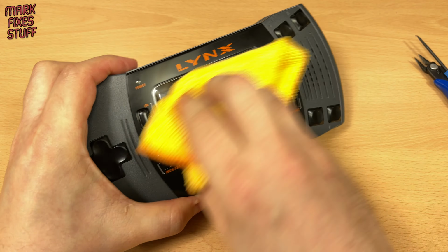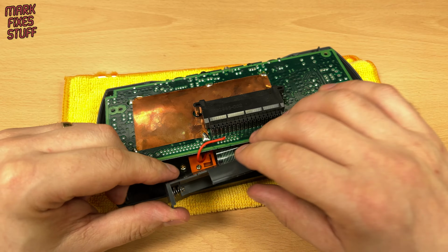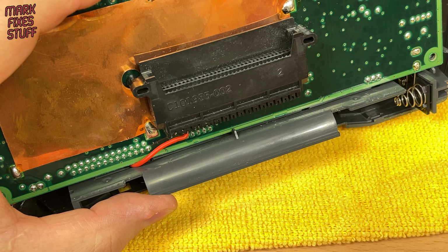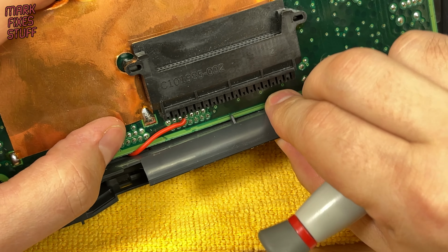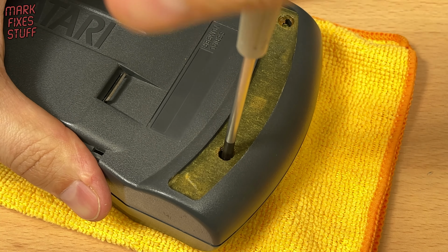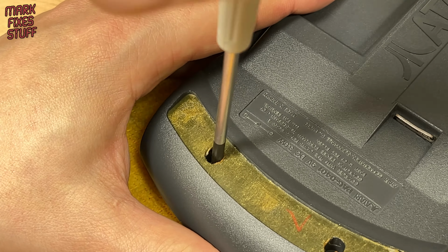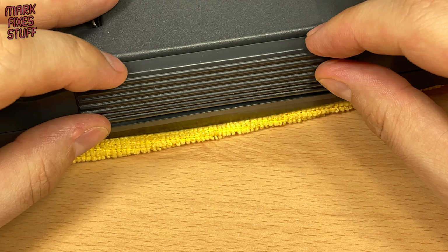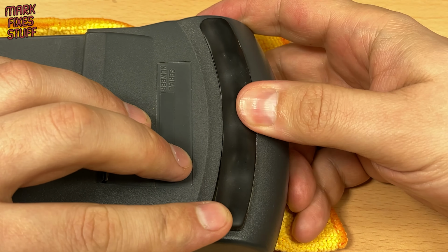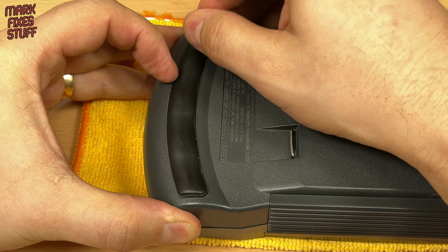Another quick buff. Before we wrestle the battery tray back into place. And secure it with this single black screw. Make sure that this lug is over the top of the mainboard. And place the back of the console on, ensuring the case closes properly. Then a spot of light screwing. Not too hard on the old screw holes, please. Replace the battery cover. And slip on a rubber. You can refresh the double-sided tape on these, but this tape is still sticky enough. Don't use anything too sticky in case you want to dust inside the screen in future.